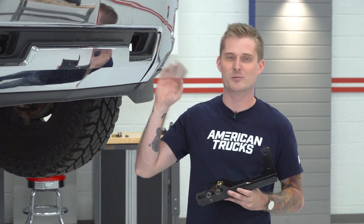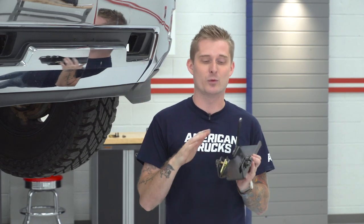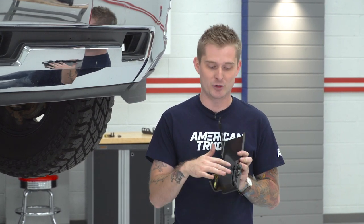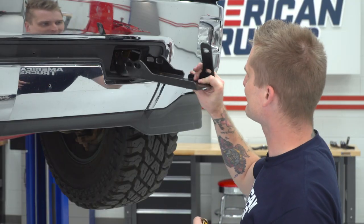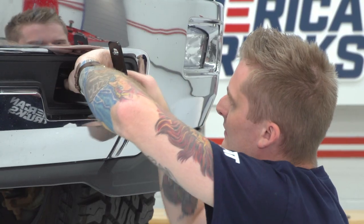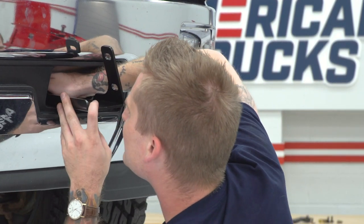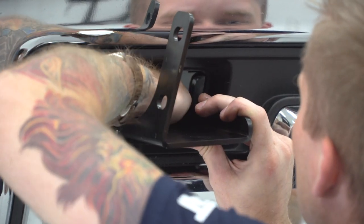We did all that work to remove our tow hooks and got all of our hardware, bumper, and grille back in place — now we can finally install the brackets for our new bull bar. It's a little bit difficult to show in here and obviously a tight fit, but I mocked up what it should look like when installed. The bolt plate studs are gonna go in the holes where your original tow hook hardware went. You're also gonna sit the bracket on those studs inside the tow hook mount on the frame, with flat washers and nylon locking nuts on each stud. To tighten these down, you're gonna need a 19-millimeter socket. It's a bit of a squeeze, so you might need to use a hand ratchet.